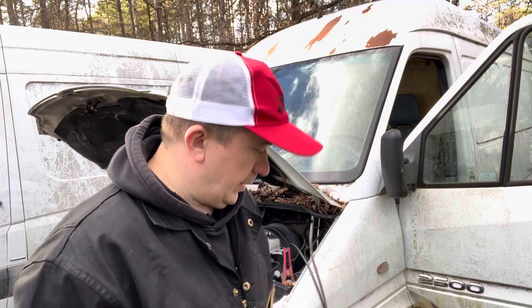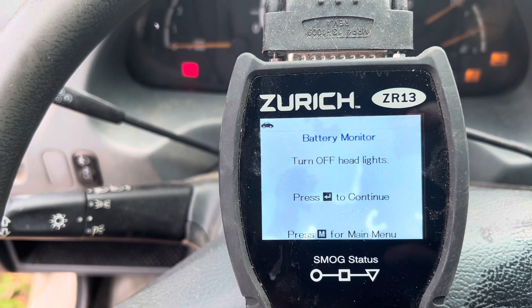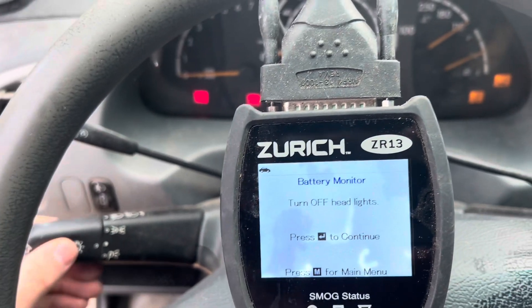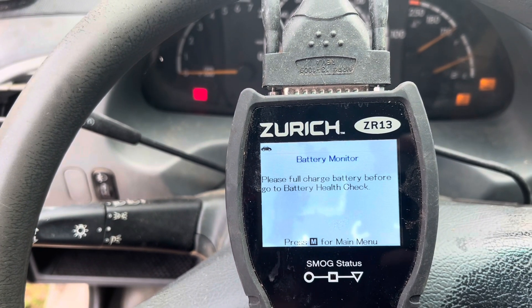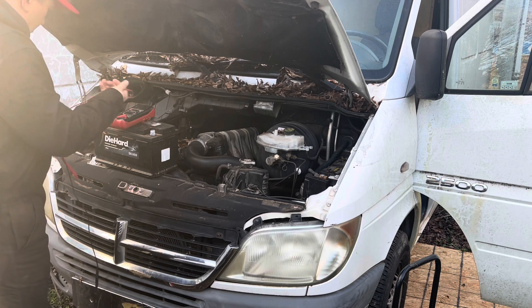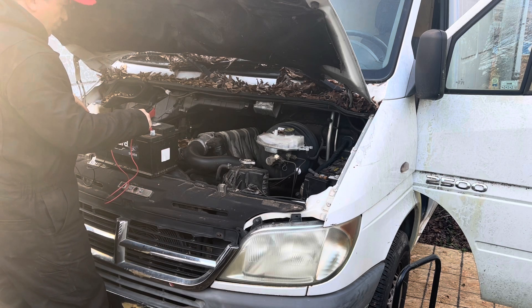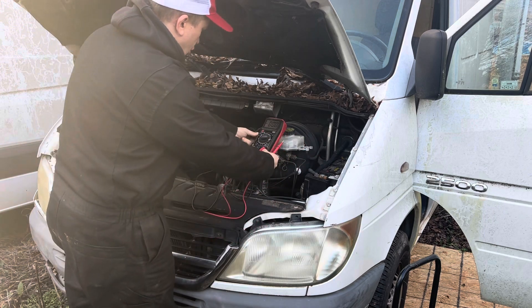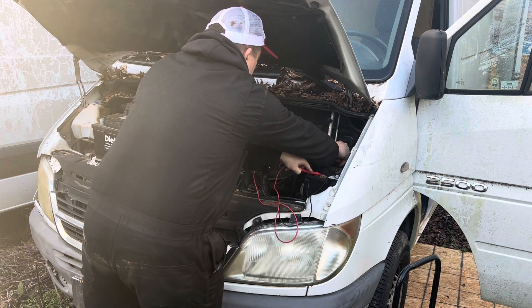I tried using one of my diagnostic scan tools to do a battery health check. It says you need to have a fully charged battery, which I thought I had because I had the battery sitting here charging the whole time. I remember this one tested the alternator — let's turn off the headlights, they are off. It says 'please fully charge battery before doing battery health check.' The battery I'm trying to install: I want to see what voltage it has — 12.3 volts. What about this battery that's been sitting here charging basically 24 hours? 10.7 volts.